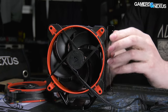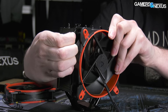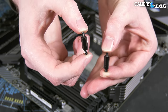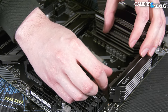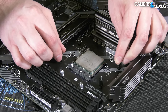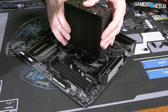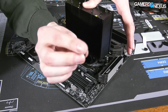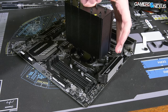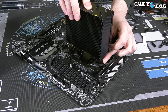The mounting hardware of the Esports Freezer Duo is simple and solid overall. For AMD motherboards, the first step is to remove the two fans by releasing the captive wire mounts, which are both easy to work with and secure. Arctic's standoffs then need to be installed onto the AM4 backplate — there are three different sets, so make sure you're using the right ones with the right thread count. From there, apply the included MX4 thermal paste or your own. Then the Freezer 34 Duo is placed onto the CPU, and the four knurled thumb nuts are tightened to secure it. Hand tightening is good enough with some elbow grease, but a screwdriver can help — just don't overdo it.